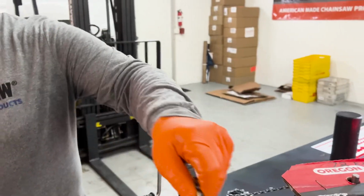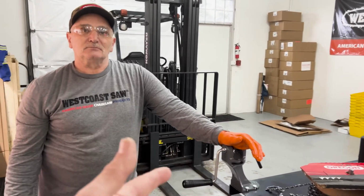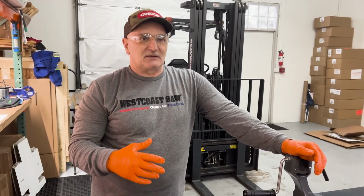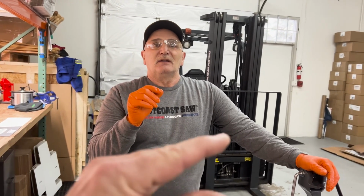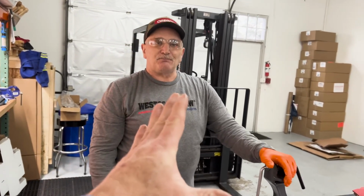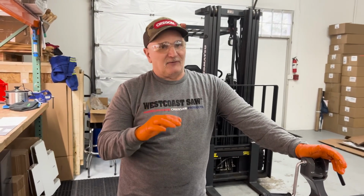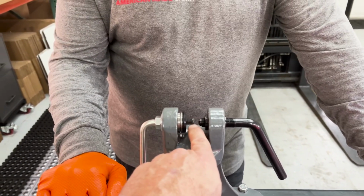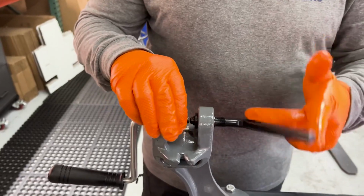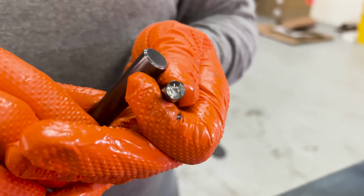So the other thing I was thinking was when we first started out, we didn't know how many times to spin. And that's right. A lot of times the more you spin, the flatter the rivet will look. It'll kind of pancake and get elongated out, where 4 or 5 spins is all I usually do. Okay. On your die here, they have A and B? A and B, and it's usually right on the very back of the die. If you can see it or not.